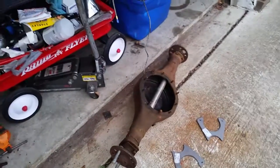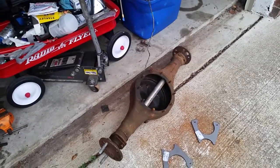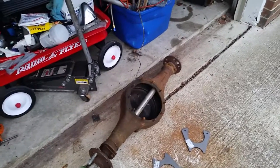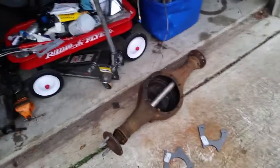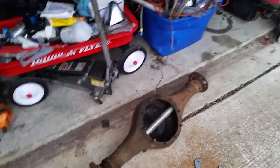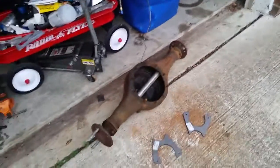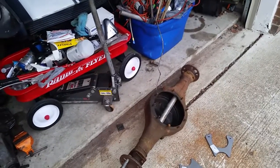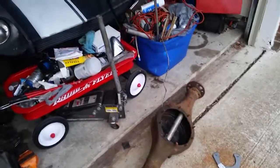I'll make like a tiny little go-kart, more or less, with a V8 and parallel link four-link suspension with a panhard bar. Then I could drop the little Subaru body on it because the Subaru is pretty far gone. Between the two of them I may be able to make one running car — they do have titles and VIN numbers. It would just be like an oddball drag car using scrap parts. I'm putting like a 2.73 or 3.27 gear ratio in it, so theoretically I could drive it far, it'll just be loud because it won't have mufflers.